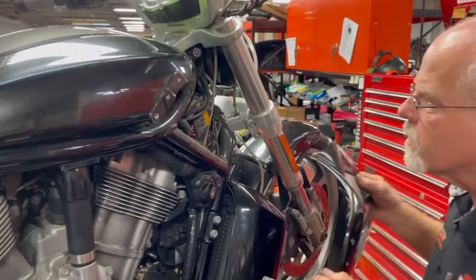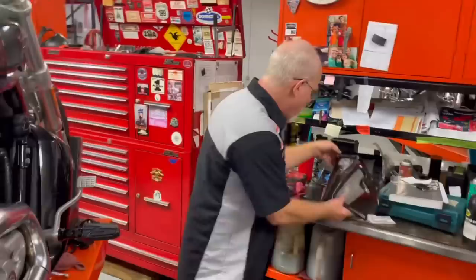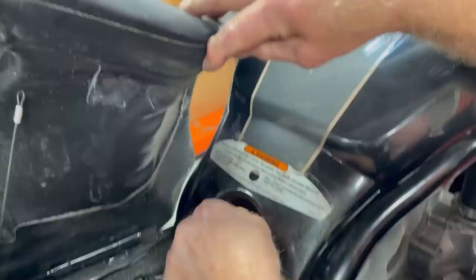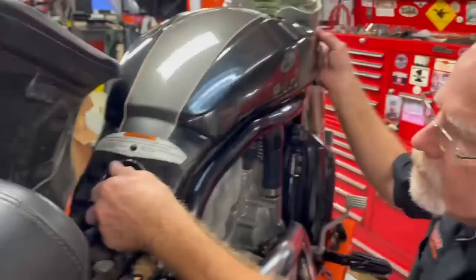The cover has six allens that take the same four millimeter allen wrench. Let's take those out and pull the cover off. There is a master big fuse. Following around, there is the negative cable on that side — so we've found the battery location, but all I can see is the negative side. To get to the positive side and maybe replace the battery, we go back to the seat, lift it up, there's a fastener — twist and lift. There's a cover on the other side, so we go over and take out that cover with the six allens.